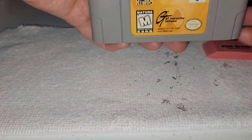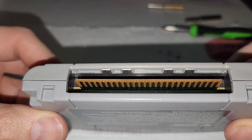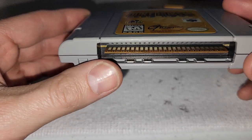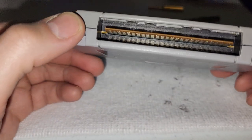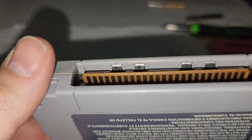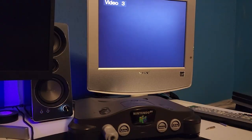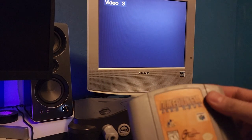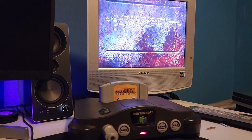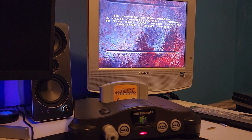There you go — you've got a nice clean game. You can look inside and see the shiny contacts. If you like, you can let it dry for a while if you're concerned, but in my experience alcohol evaporates pretty much right away. After about five to ten minutes I'd usually play it. I've got my Nintendo 64 set up — I'll put the cleaned game in there. When you turn the power button on it should just kick right on, just like that. Now we've got a nice clean game that should come on every time and not give us any trouble.